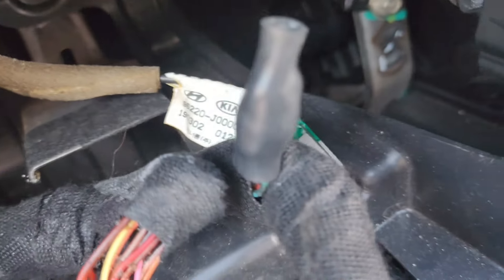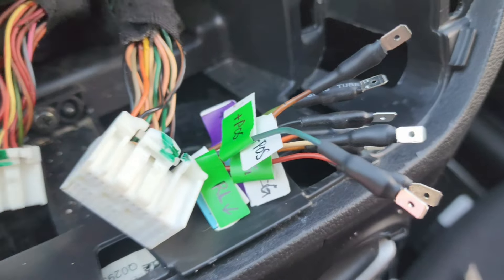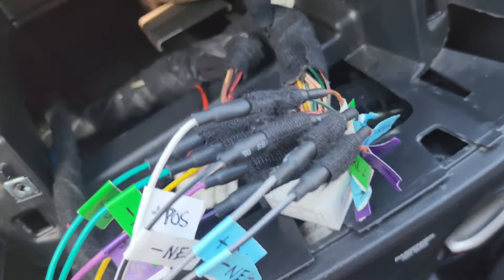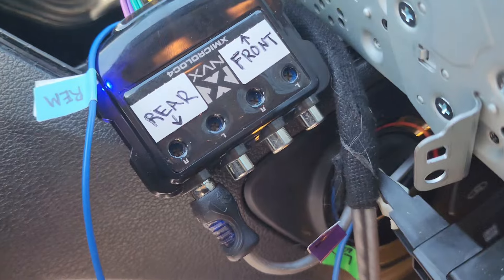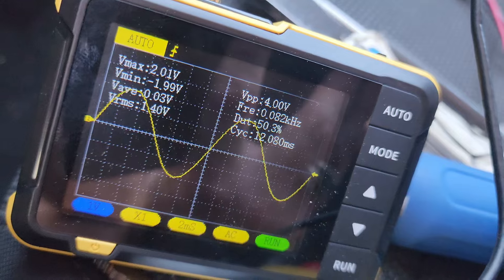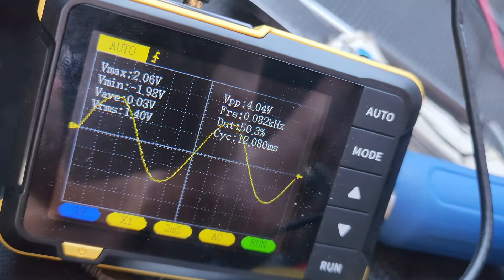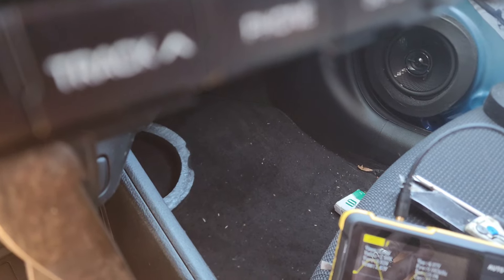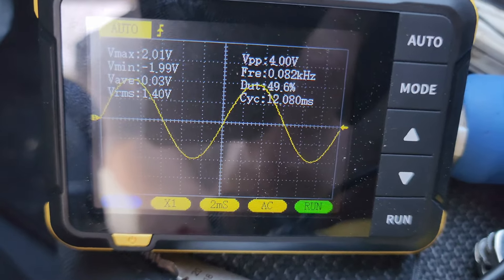Extremely clean. I don't think I'm ever going to turn the volume up higher than around there. I tested and taped all that back up — those are the old speaker wires, those are going to be the new terminals coming out of the head unit, and then 12-volt constant and ground. I've got to put a fuse on there like a little 3-amp or something. Got the oscilloscope set up, this powered up — you can see the blue light. Head unit is set to 40; we're going to be safe and give ourselves a little headroom. That gain is maxed on here and I don't have any clipping, so 40 with max gain is fine. I've got to make sure I tell my wife who drives this car not to go above 40 — she's got 41 or 42 but I'm going to tell her 40.